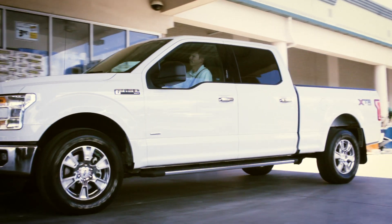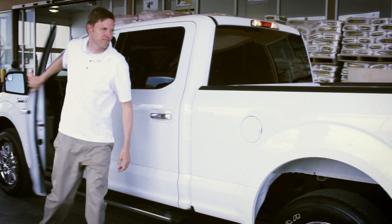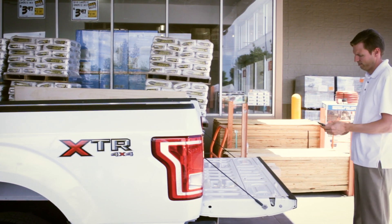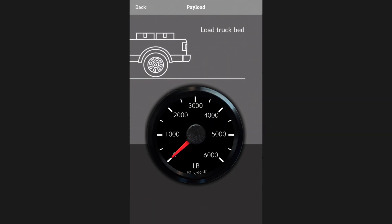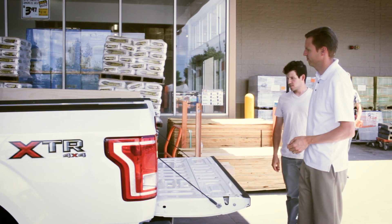In order for the payload feature to work, All-Gage needs to get a measurement of the pitch or tilt of your vehicle before it's loaded. Park your vehicle in the spot where you intend to load it, then get out of the vehicle and press Ready. Make sure that nothing is touching or disturbing the vehicle in any way while All-Gage takes its additional measurement. Anything that affects the pitch of your vehicle after this reading will be measured as a change in payload weight.